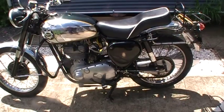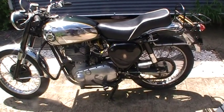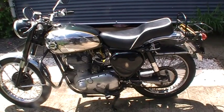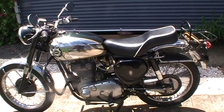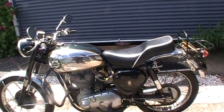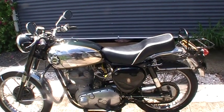This kit from Pearson involves a starter motor which is down under the engine plate, below the gearbox basically. It's a little bit low, but the centre stand on this bike hangs a bit low so I'll just have to be careful over speed bumps. There's a chain drive that comes up into the centre of the inner primary, and then there's a crossover Bendix drive which is kind of like a big Acme screw — like in your lathe. When the starter motor spins the sprocket behind the primary it throws that out, and that engages a ratchet — like two ratchets — which is very similar to what is on your Triumph and BSA kickstarters.